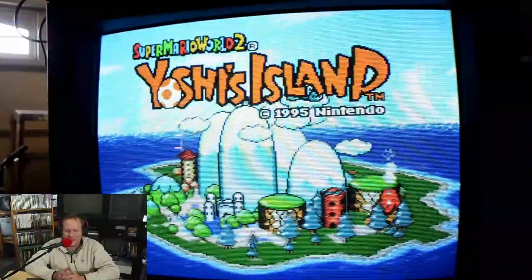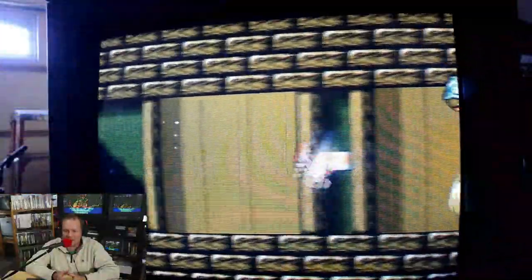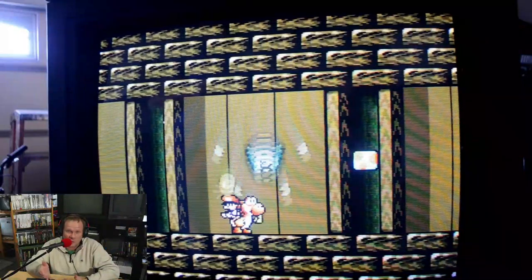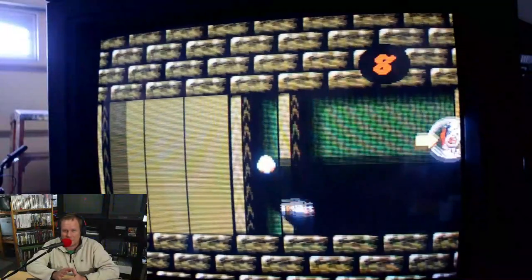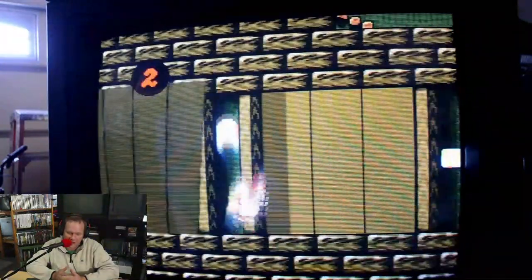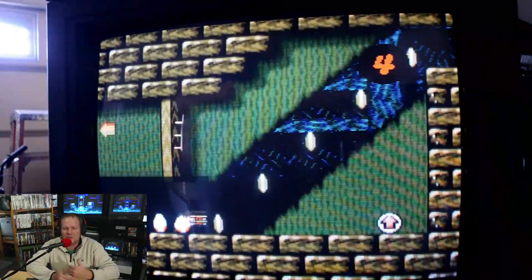This is a shadow mask tube so it does have a slightly different look than the Sony, but just a magnificent thing to behold. If you see something like this, just note that you're going to want to get inside and inspect before you just try to run and start using these things. A lot of times you'll get lucky and there won't really be a problem, but at this point in 2020 this monitor is almost 30 years old and had obviously been used quite a bit. The main problem was the power supply — a dirty job, but I'm super glad to get it fixed up and back into Dave's hands so he can enjoy it.